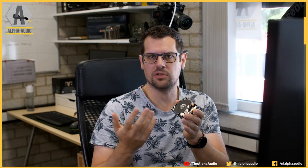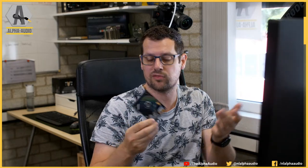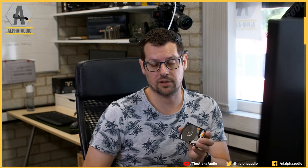You need to format a drive to be able to use it. It will distribute all the sectors and say this is the block size and stuff like that. It's very complicated, and I'm not a technician, but I just know that you need to format it. But of course, the rotating platters spin either at 5400 or sometimes a little bit faster, like 5700 RPM on some drives, and most of the desktop drives will spin at 7200 RPM. And then you have the server drives that go beyond 10,000 RPM. The faster it spins, the faster it will be. And it can search faster because the platter spins faster.